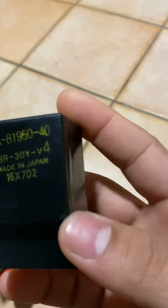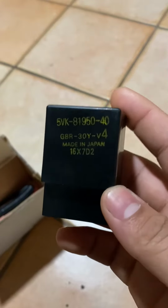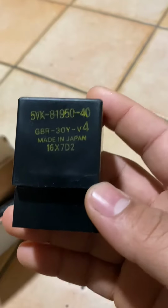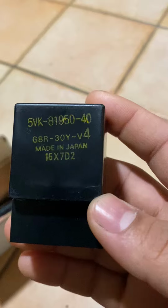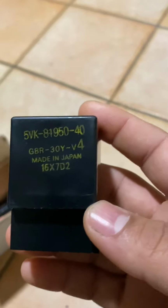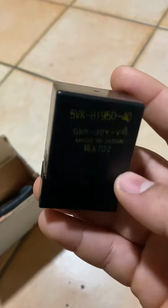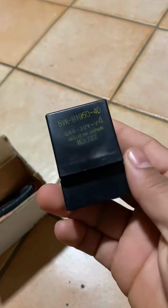So before you replace your gas pump or take any action, make sure your relay is sending the power all the time. Like I tried a few turns, like 5 turns. Try to turn it on 5 times with a meter. Can also be that you can hear the pump every time you turn it on. So that's what you need to know before you replace your gas pump.